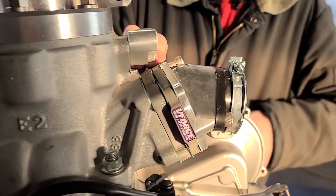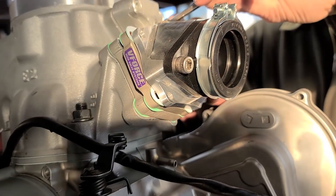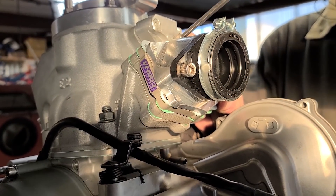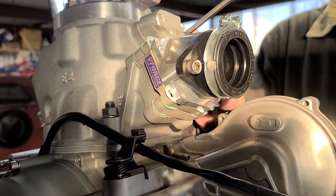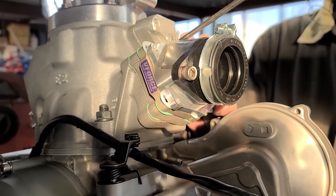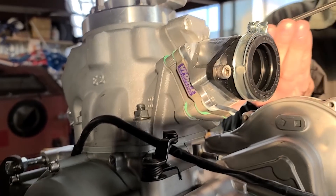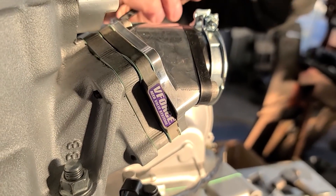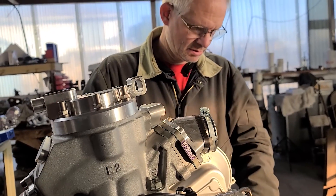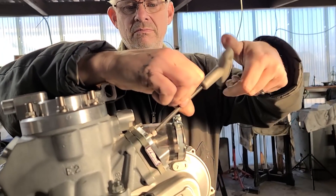You've probably noticed this is a totally different intake setup than before. This is Sunny's intake, designed to correct the angle difference from the ESR cylinders to OEM cylinders. We've got V-Force 2 reeds and the reed spacer - both of those weren't there before. We were running ESR reeds, no reed spacer, and a UPP boot. On the dyno we found that this new combination was its favorite by far.